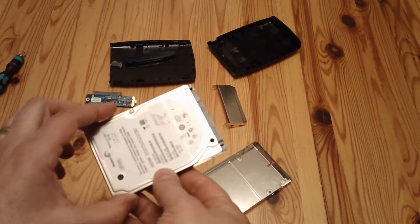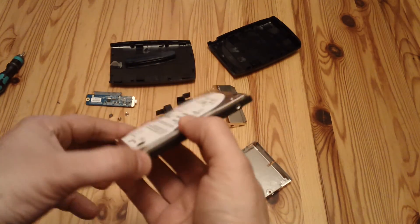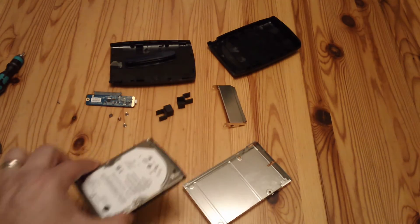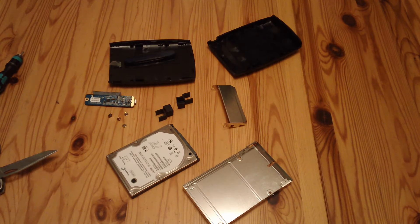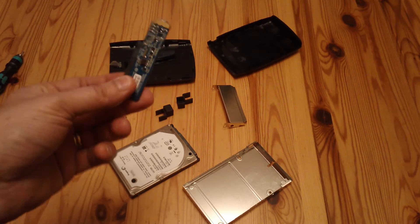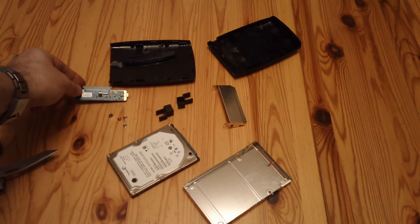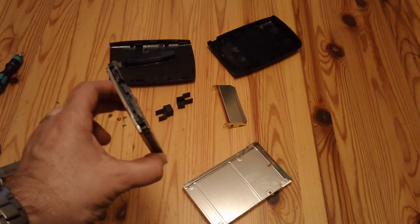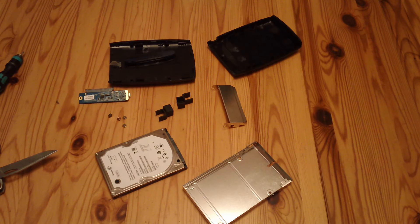On this particular one, I bet this drive is absolutely fine. So if you've got one of these and you think you've lost your data, you probably haven't. Take it apart — now you know how. Disconnect the little SATA to USB interface circuitry, because that's probably what's broken. Plug that into a caddy or another machine and you've recovered your data. Any questions or comments, stick them in the comments. I hope the video is helpful — thanks a lot for watching.